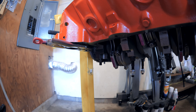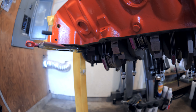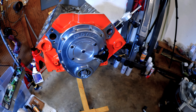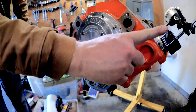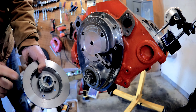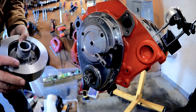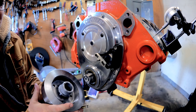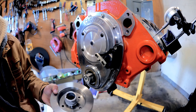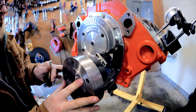Back here I have just a pair of vice grips clamped onto the crank resting on the block, just so the motor doesn't turn over while we're installing the balancer. The dial indicator here — we're going to use that to verify top dead center on the pointer to the balancer so we know that's correct. We'll do that after the balancer is installed. Right now I have assembly lube on the outside and inside of the balancer, on the crank, and on the seal — that will make your life a lot easier.